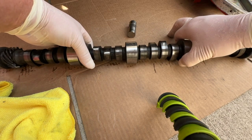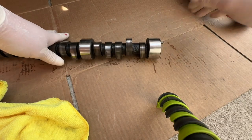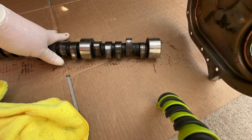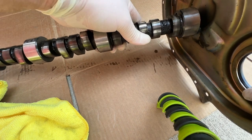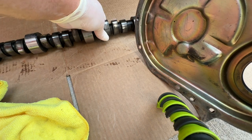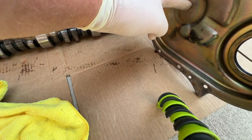And so the cam button helps solve that. I'll show you exactly why and how. First off, this is your timing chain cover, okay? Roughly it's about like this. If you just let your cam go willy-nilly, it could have the freedom to go forward and hit right here and wear a hole in here and cause all kinds of damage, okay?